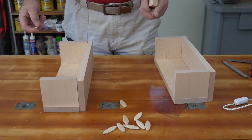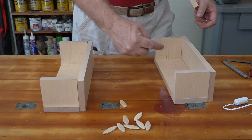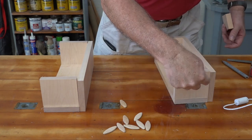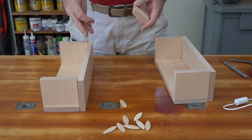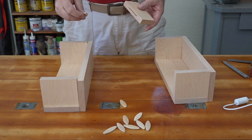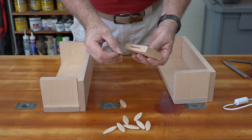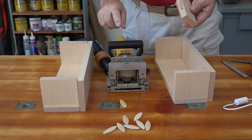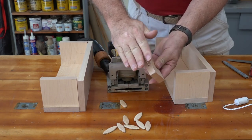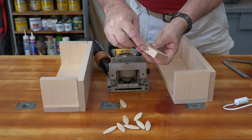I have the basic shapes made. After I'm done, I'll cut the angle so it will fit up onto the ceiling, but first we have to put these all together. My favorite technique is using a biscuit — these happen to be number zero. You cut a little slot with this biscuit joiner; it holds and lines up the pieces of wood together when you're gluing them.